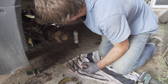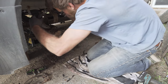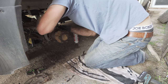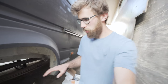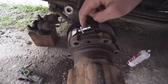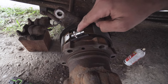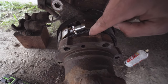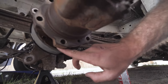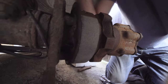Got the wheel in there, got the first spring in there, and I'm putting this around the top. These little springs go around the backside — find that hole. Got the shoes on and the whole assembly ready to go. Both pads are on. When you put the adjuster wheel in, you want to make sure it's facing downwards so water doesn't collect inside. Also make sure it's well lubed with brake lube because these can seize up. The top spring clips on either side and underneath there's also another spring that goes right underneath there.